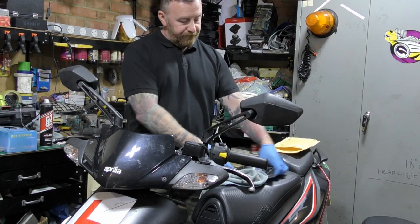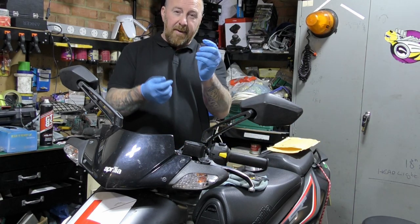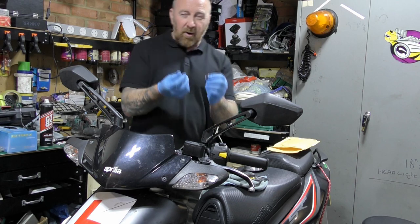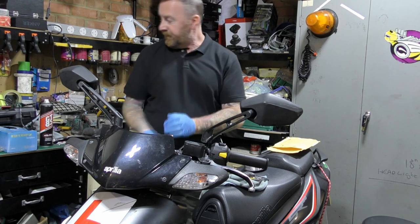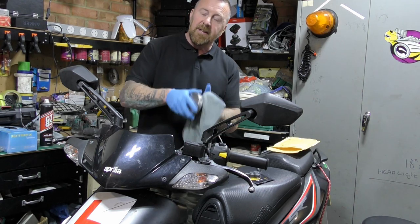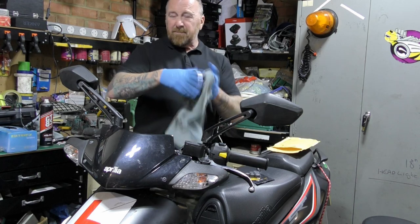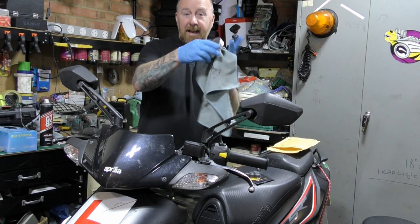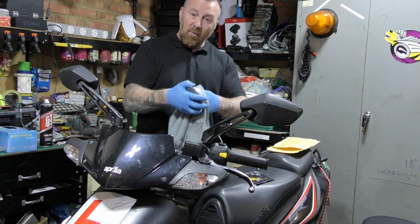Rollers. 6 grams, I've said that in so many of my videos. These were coming out, I did weigh these, because of the flat spot coming out about 5.5. But, you know, what causes this? It's your belt. Your belt, as it goes round, sprays the dust everywhere. It gets in here, it gets in them there, you know, clean them out.